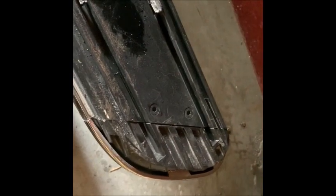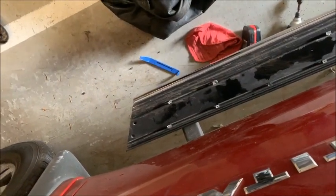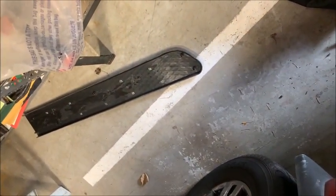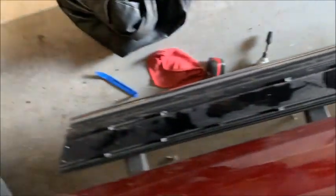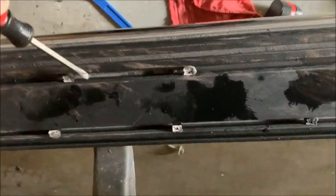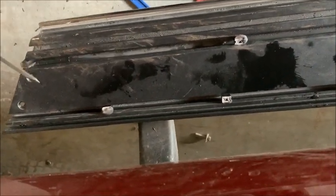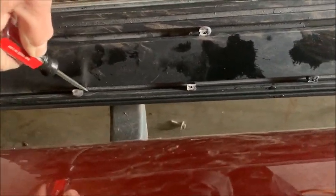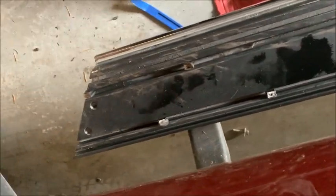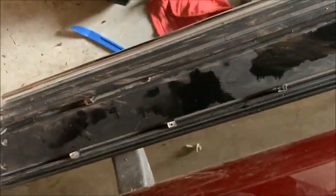And then we'll continue with the inside wiring. All right, I now have the front piece off the running board, but I did forget to tell you something. I told you the spring clips break off of that when you pry it off, and what happens is the spring clips are stuck in the channels here. So just remember to take all these spring clips and push them out. Push them to the end and take them all out. They all come out very easily. Anyway, so I'm going to put the camera down, take those spring clips off, run the wiring, and then we can do the inside.